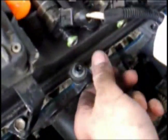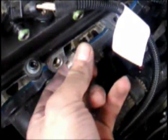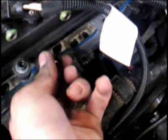One thing of note is that on these mounting blocks, the silver side, if I recall correctly, goes into the head, and the black side with the insulator is what faces the fuel rail. That's real easy to get backwards, because you can just flip them around and they'll fit either way. But the black side does go towards the fuel rail.